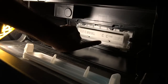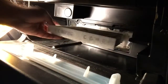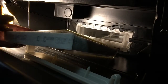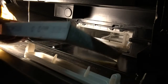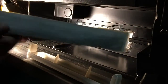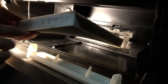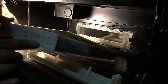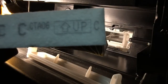Notice how the filter is pointing upwards — you want the new one oriented the same way. The hard side is on the outside, the soft part is on the inside. This is the way it came in, and this is the way it's going to go back in. The airflow side is facing upwards, so make sure your new one also faces upwards.